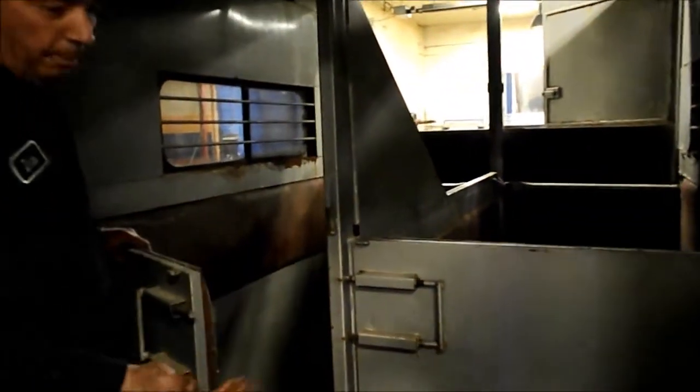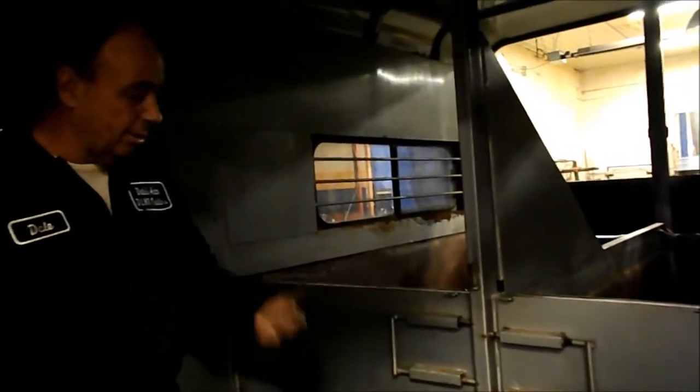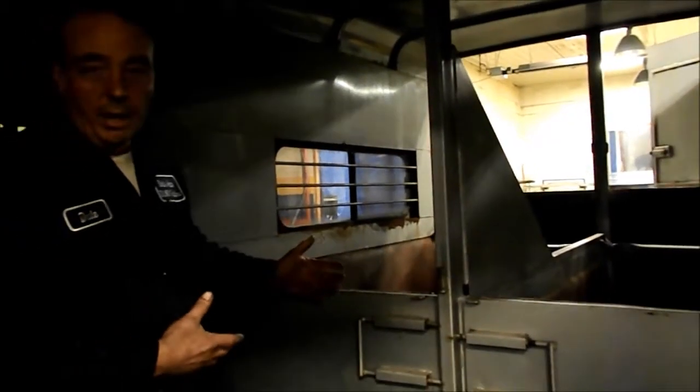You can check your ramp — this one has a ramp in the front nose. I recommend you go in and check all your divider latches to make sure those are all functioning right. If they're not working perfectly, that's something you can use against the price of the trailer, but at least you know what condition these components are in. Check your interior lights to see if those are working. Another big thing is you need to lift these mats up and inspect the floor, because a lot of trailer floors rot out.